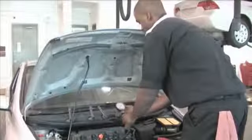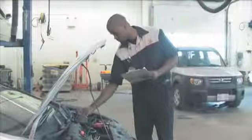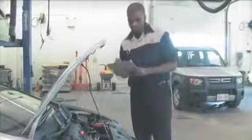The technician's assistant will now crank the engine over with the accelerator pedal fully depressed. It should crank a minimum of three cycles to obtain an accurate test. The technician will note the reading and document it on the mechanical inspection checklist.